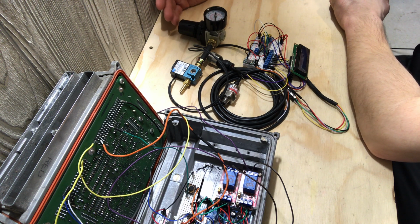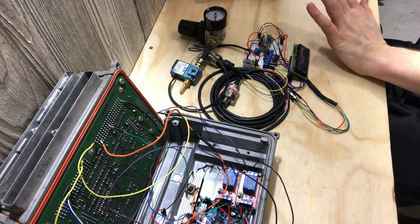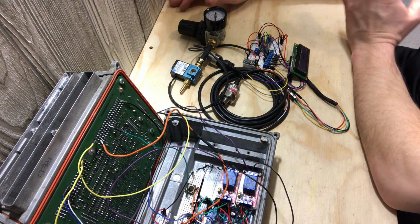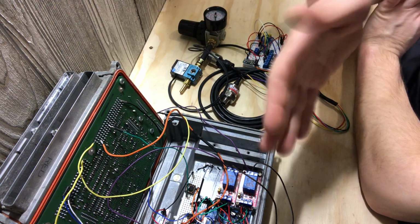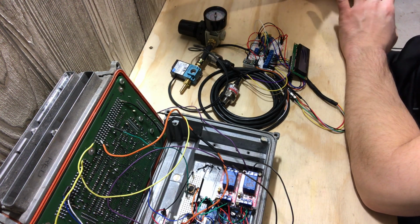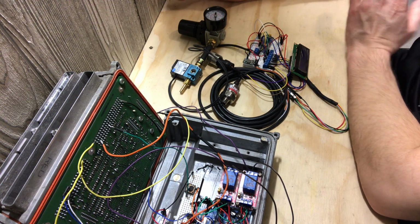And then when you go to third, it's going, hey, whatever you have for me for boost pressure, I'm giving you everything that you did program me to do. Or you could, I mean, it's up to whatever anybody wants to do on their build. But I'm just saying that's how I'd like to incorporate that. Again, information coming from the J1850 to the Arduino, letting the Arduino control the MAC valve. So I'm trying to explain as much as I can.